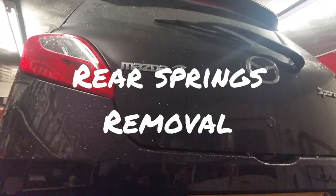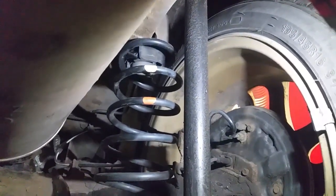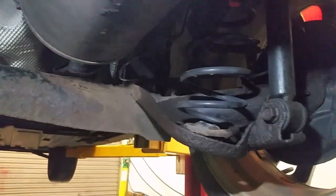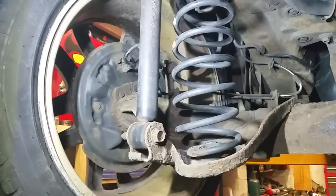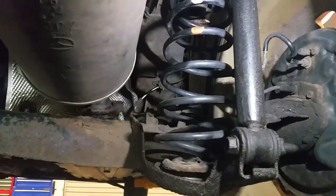When I took a free test drive I found that it was quite bouncy at the back. So having a wee quick visual underneath the car, we can see that the shock absorber has leaked all the oil out of it. We can see the seat at the bottom is completely soaking wet. If we compare that over to the other one, it's nice and dry there.